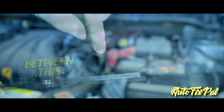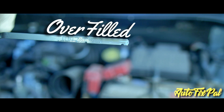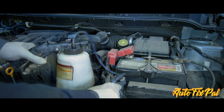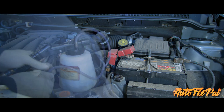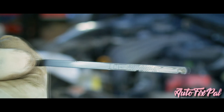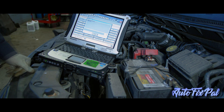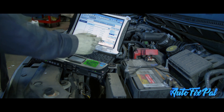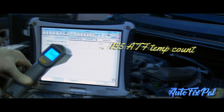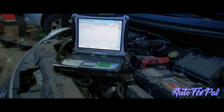No, because there are variables such as ambient temperature and the accuracy of the temperature gun. Keep in mind, the temperature in the shop where the tests were performed ranged anywhere from 65 to 70 degrees. So if you do end up setting your CVT fluid level using a temperature gun, make sure that the ambient temperature in the room, shop, or garage where you're doing the service is 65 to 70 degrees. If not, the results may not be the same.